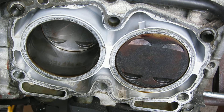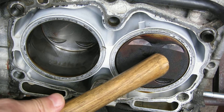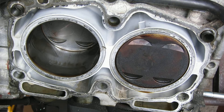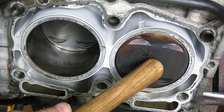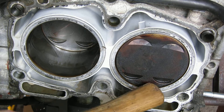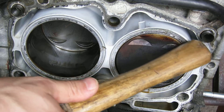I'm going to do this side first. You want to get the piston to top dead center like this, and then you can see just ever so slightly the piston starts to retract in the cylinder. You give it a little push and you can see it moved just a tiny bit. I can actually feel it — it's just a small amount. You can see that when the piston's at top dead center it's pretty much even with the top of the cylinder head here.